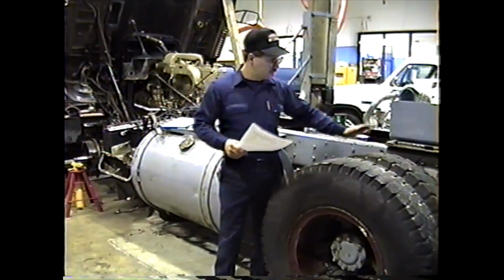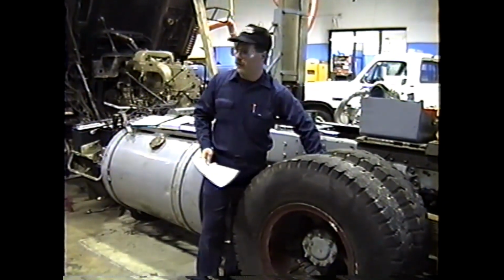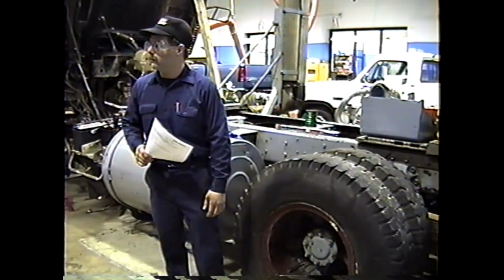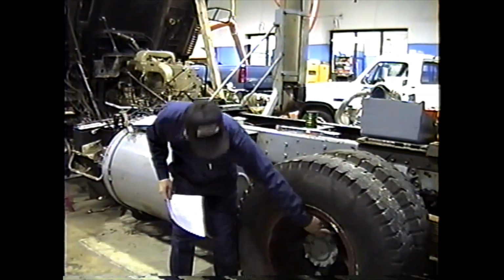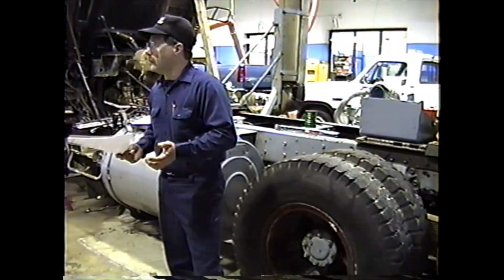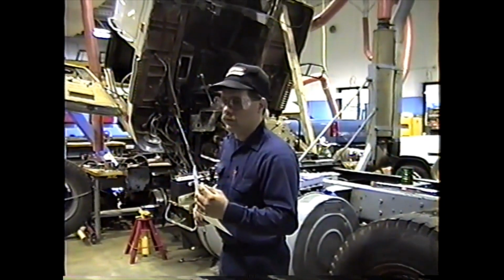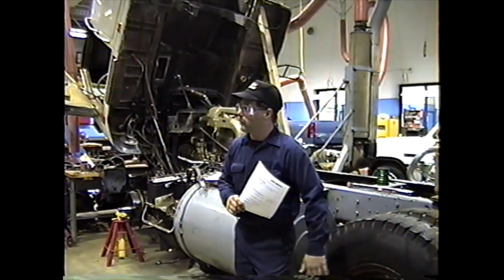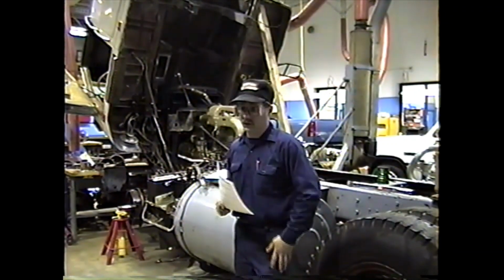Okay, and of course, the other rim on the inside. How about where it mounts? Take the bead. On the spokes, yes, on the spokes itself, they can crack. Okay. How would you clean those surfaces up to inspect them? Just wire brush them off, or like I said before, check for rust stains. A rust stain is usually a sign of something cracked or loose.